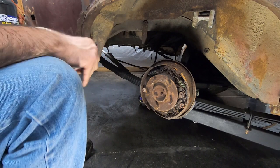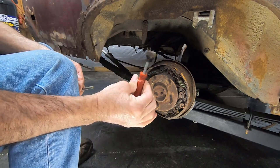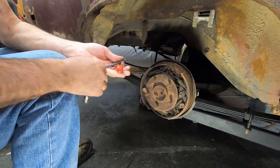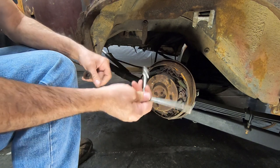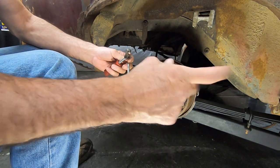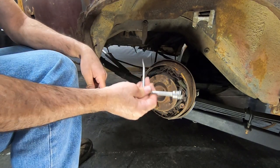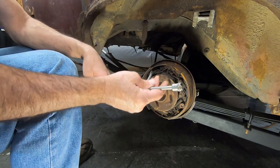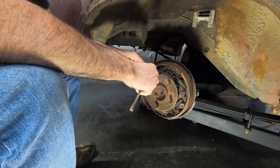There are two main tools you need to get this apart without having to fight anything. You need one of these, and this is for taking off your little spring cups here. And you need one of these, and this is for removing and putting on springs. Now, you can get one of these that's got the big hook and stuff on the other end. It's not really applicable to this, but if you can find one of these, this is the way to get it. I'll try to find one of these and this and put them in the description, because they're pretty cheap tools that make drum brakes really, really easy.